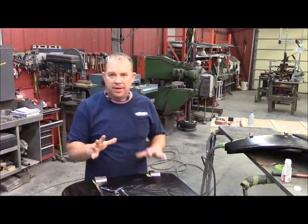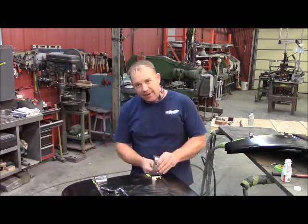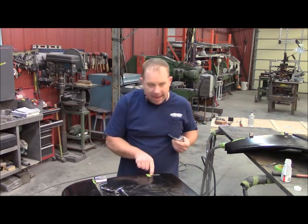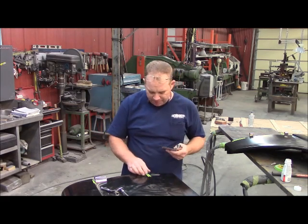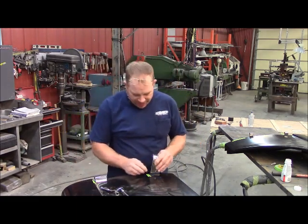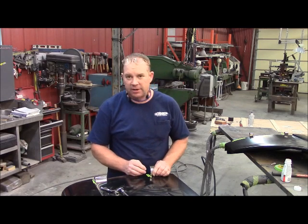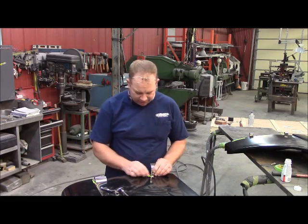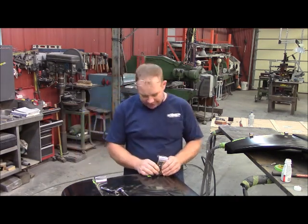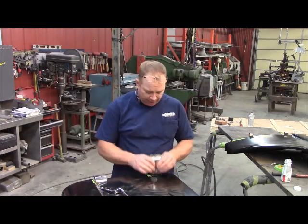I'm going to show you a little something that's going to save you some grief and prevent rust in a prone area. When this hinge is in here and the bolts are in, there's enough movement in these bolt holes to allow it to touch the top side of this opening. A lot of them are like that. I always check that and then file it out — I'll do the top the same way. If not, it touches right against that hinge, sets and squeaks and rubs and starts rusting. You'll see this a lot on these cars; it'll crack and make a mess. I'm going to stop that right now by opening that up — put the bolts in, check that it won't touch in any way, and make sure I've got enough clearance for that hinge.